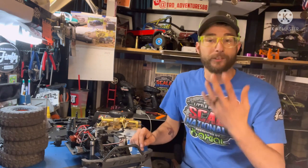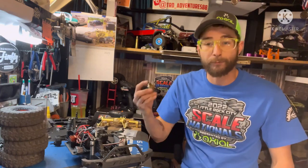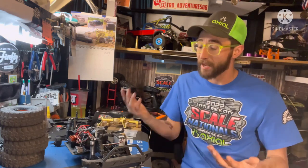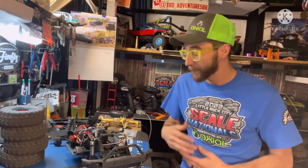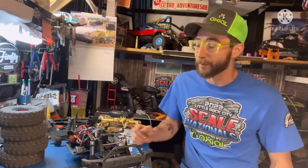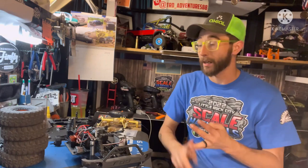Next, as you saw with the scales, I mentioned some brass portal covers — that's something I do recommend. I do the same thing on TRX-4s, Gen 8s, if I ran them. I'm okay recommending a brass outer portal cover on those style of axles in the front because it gives you just enough more forward bias. It's not rotational weight, it's weight down low, and it's hidden by your wheels. Options are out there from Key City Hobby, A-Main Hobby, Town RPP Hobby, Tower Hobbies — you don't have to go crazy.